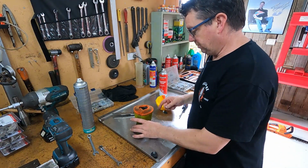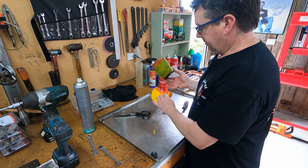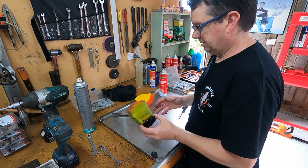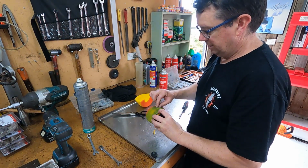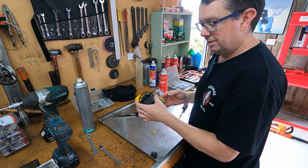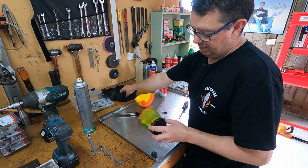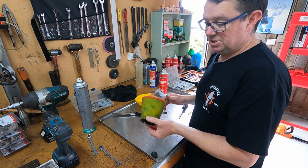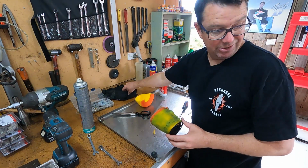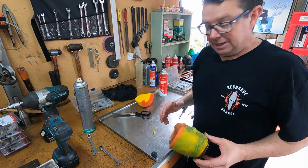You've seen the air filter before. Just came out in pieces. So I've just sacrificed a YZ250 air filter. Just cut it in half, glued it together. That's all glued, that's all solid. Screwed it back onto the plate there, but that'll smush in there okay till we can get the right one ordered for it. Something's better than nothing, I suppose. Anyway, we'll get that in there, get the seat on, and kick her in the guts, I suppose.